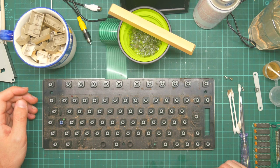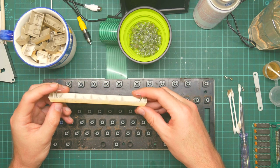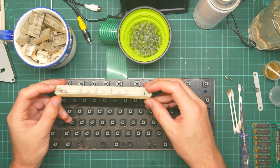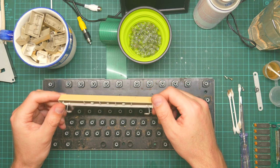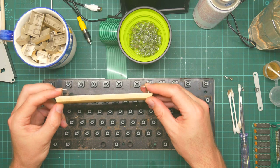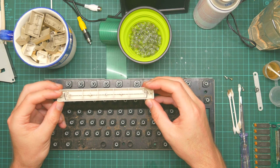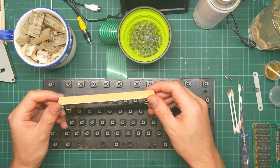Yes, well, you can see that a lot of the keys are really quite yellowed, so I'm going to need to, at some point, bleach them with hydrogen peroxide. I don't think I'm going to do that today. I mean, it'll work perfectly well yellowed. I want to do some experimentation first. I do not have a ready source of UV that I'm willing to trust, so I'd want to use heat instead. You need to catalyze the reaction or it's far too slow to be useful.